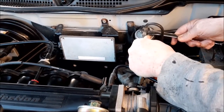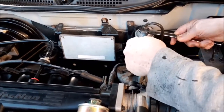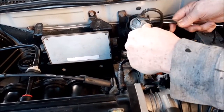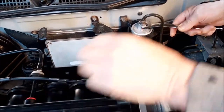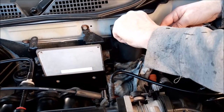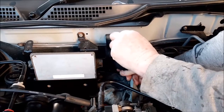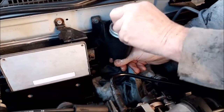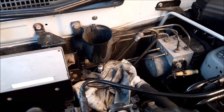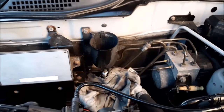As you can see, we've got one spanner on the filter itself to hold it while we undo the little nut on the union connection. We've also put a rag there so any fuel that does spill out doesn't run too much into the engine bay — you can never avoid it completely. That's the fuel filter out, with just a little bit of fuel dripping out but not lots, so it's not too bad to remove. It comes out of the plastic casing fairly straightforwardly once you've got both union connections removed.